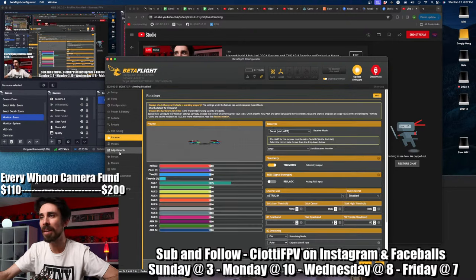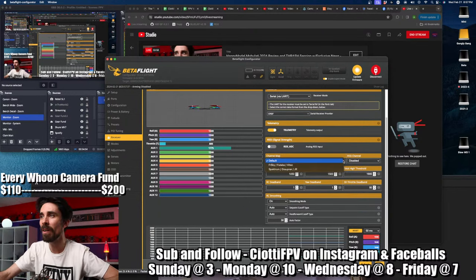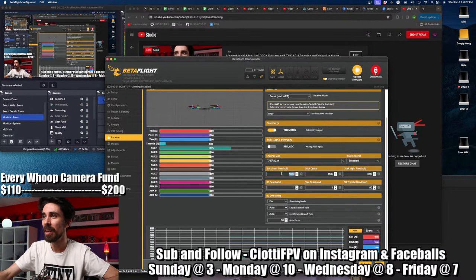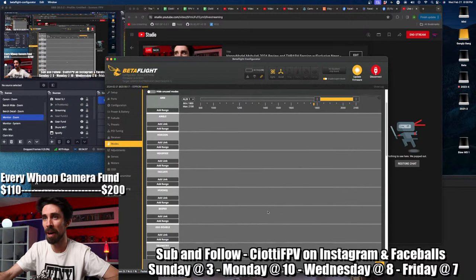PID tuning, let's come back to that. Receiver tab, Crossfire. All right, so this is on AETR. For whatever reason, when I was new, my transmitter was originally on TAER, so I need to change that. Stick low threshold, I'm just going to assume it's going to be fine. Move that to 1,000 and 2,000. A little bit of extra deadband just so that we don't have any weird jittering in the middle. And then I like a little bit more RC smoothing, so I'm going to bump this from 30 up to 100. These are just personal settings. You do not need to change any of this stuff. This is just going to make it a little bit more normal for me to fly.